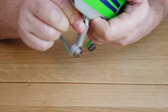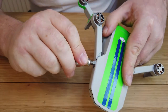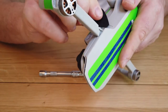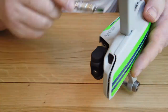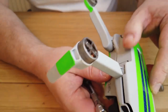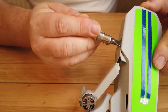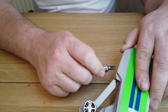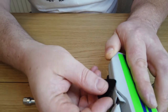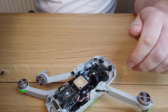As you can see, I've already started to pull the top part off. You kind of have to get it from the front of the body. With the guitar pick, it's good to get that in first and just pry it off. The guitar pick isn't sturdy enough to get in and actually pull the top shell off, so I used a flat head screwdriver — just be gentle. Take your time because you risk putting too much pressure on and breaking the body since it's quite brittle plastic. Just work with the guitar pick and it comes off.